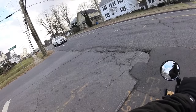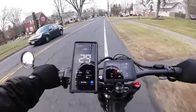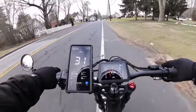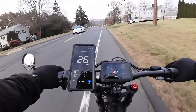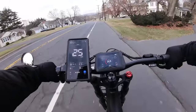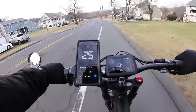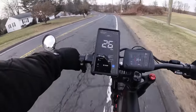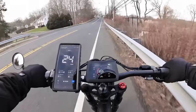Let's check out what the pedaling is like at higher speeds — see where this thing likes to ghost pedal. I think it has the same gearing as the XT600, which started to ghost pedal around 25. I can actually get up to about 30 miles an hour with this one — I'm moving my legs relatively quickly but I do have some resistance there. I'm going to try and save some battery on the way to the top speed run, so right now we're just coasting downhill. We're going to go down and back on the same road to negate the effects of wind and gravity.